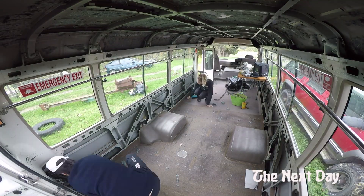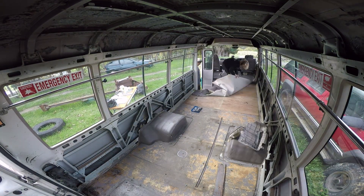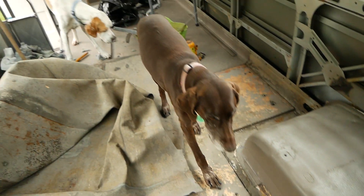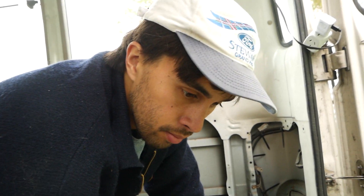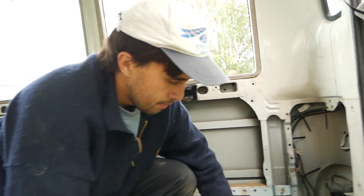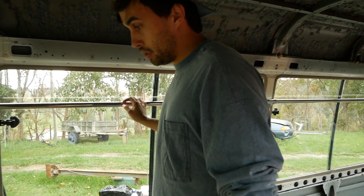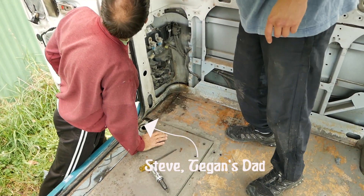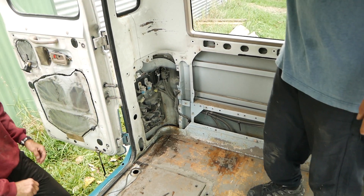When we got to the bus the next day, our first task was ripping up the floor lining to see what sort of state the ply flooring is in. We're trying to remove some of this subfloor ply because it's a bit moldy. That's definitely something probably from the window here — I need a look at that. There's a bit of rust down there, and we're on an angle right now so there's probably no reason for it to drip.